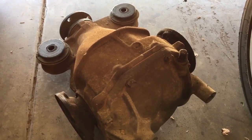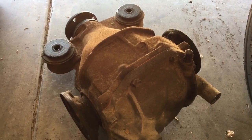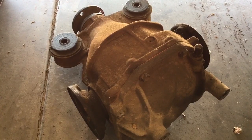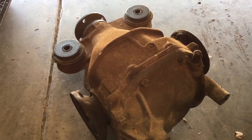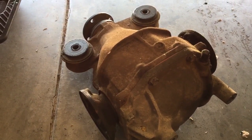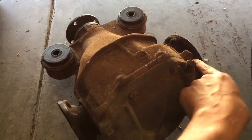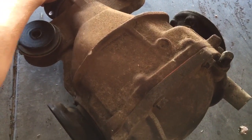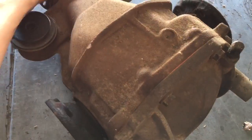This is how you tell if a diff is an open center or a limited slip differential. This will work on all types of LSDs — Torsen, clutch, and cone, plus a couple of other variations, but those are the main ones. Say you've got the diff center or the diff pumpkin out of your independent rear end, and you turn the tail shaft. This is the tail shaft connection, and these are your stub axles that go to your drive shafts out towards your wheels. If you grab this, note the direction that both of these turn — they're both turning the same way.